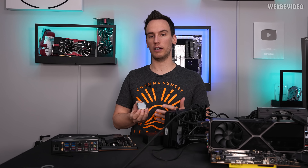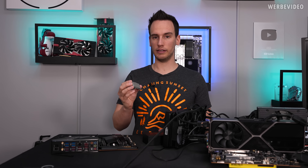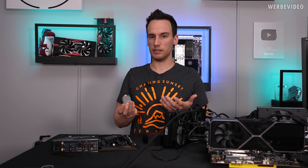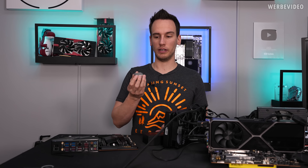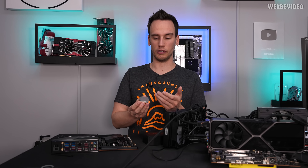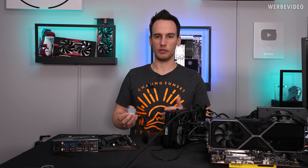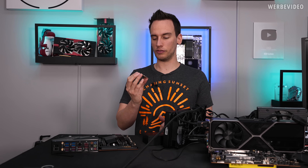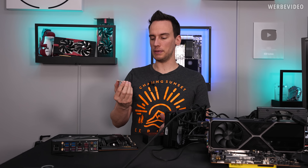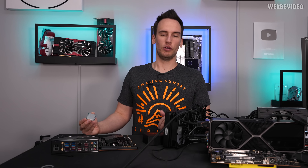We will check out what changed compared to something like an 11900K. We will also do the delidding in today's video because I couldn't tell so far what the risk is involved in delidding a 12900K, simply because I couldn't take a look underneath the lid. Usually if your CPU is alive and there is a risk of taking off some SMD caps or anything that could damage it, it's maybe not a good idea to do this process early. But since the CPU is dead anyway, no more risk.